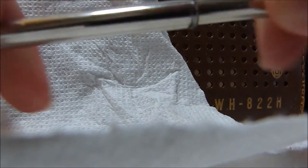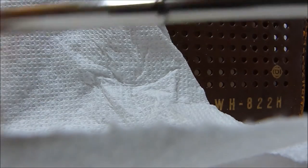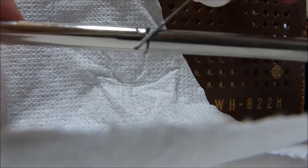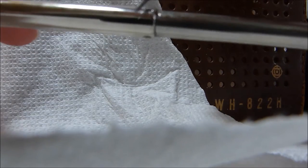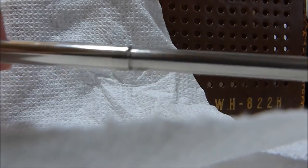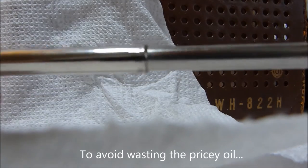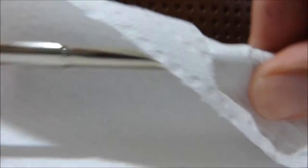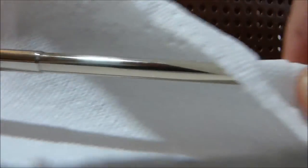So that's all you do — just work the oil into the inside of the antenna, kind of sweeping it back onto the gap between the two sections. And now it moves quite well. Then just use the paper towel to wipe the antenna down, and do that several times to clean up the excess oil. You basically only want oil to remain in the sliding contact inside the antenna.